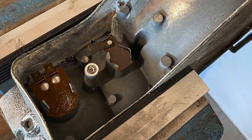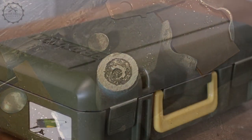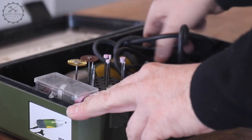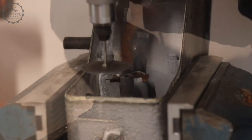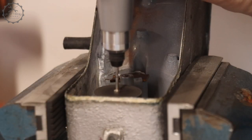At this point, I put away the whole thing for at least 3 weeks, when the purchase of this little multi-tool opened up a new perspective for a repair, as its tiny cutting discs allowed me to do surgery inside the housing. I cut off slice by slice till the entire screw was gone, and after that creating new threads in the soft material was a breeze.